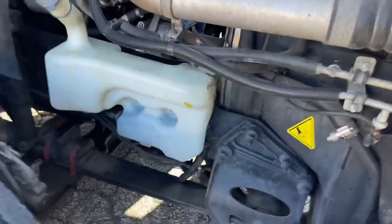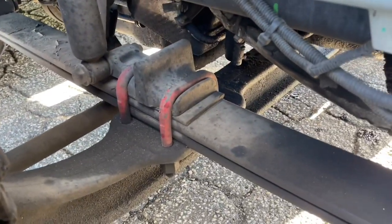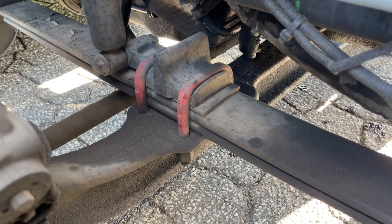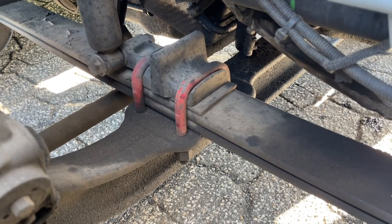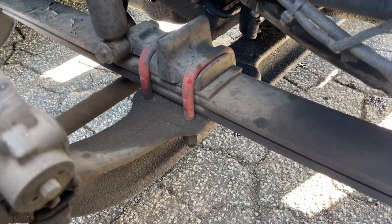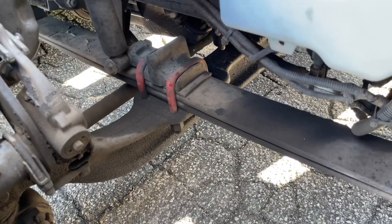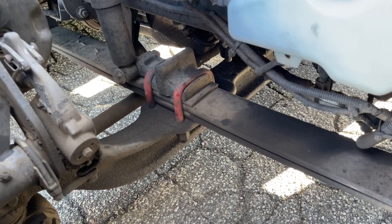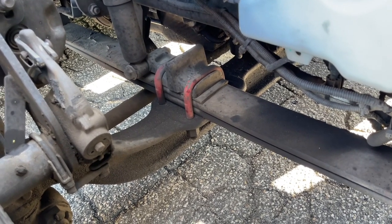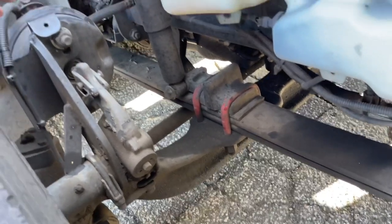So what we did was — there used to be a three-inch block right here. Actually the block is tapered from the factory: one side is about three and a quarter inches, the other side is about three inches — it's tapered to set the pinion angle correctly from front to rear. We took the u-bolts off and used frame jacks — air jacks — underneath the axle. We did one side at a time so everything would fit right.